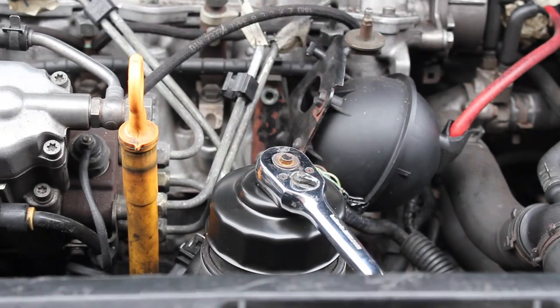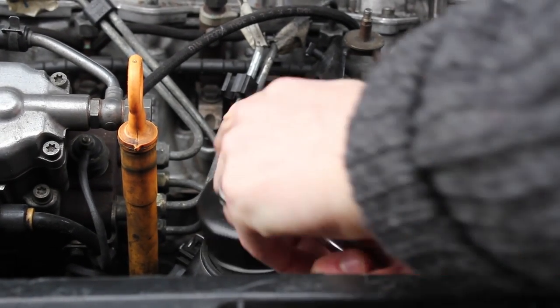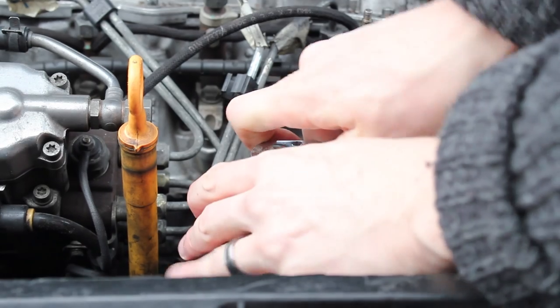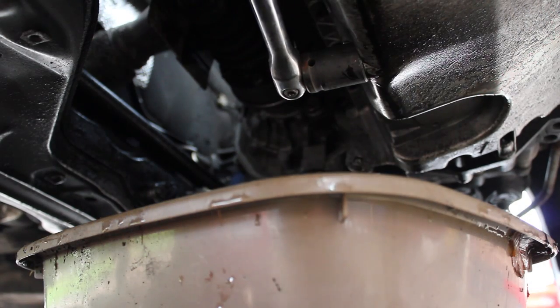You fit it over the oil filter. So unlike normal cars where it's a metal filter, you have a plastic cap and inside there's a paper filter. The cap is a little bit tough to get onto a socket at first with an extension, so I just did mine straight, as you can see there, and it undoes fairly easily.